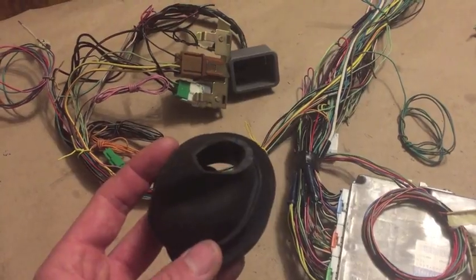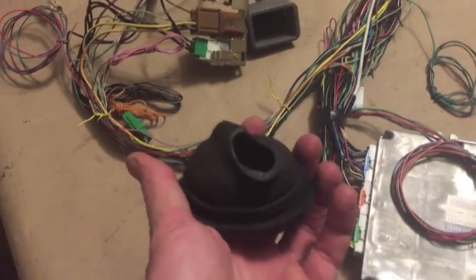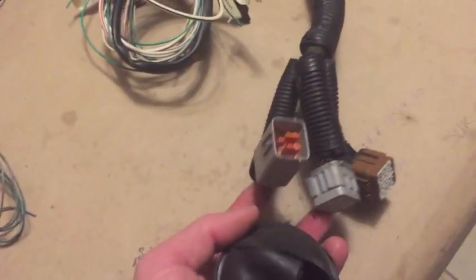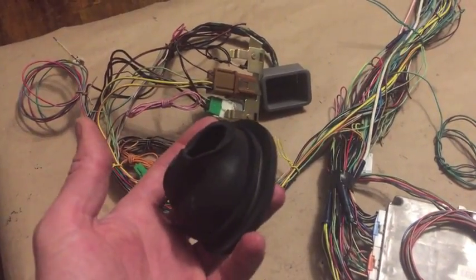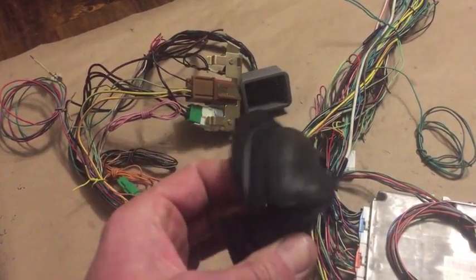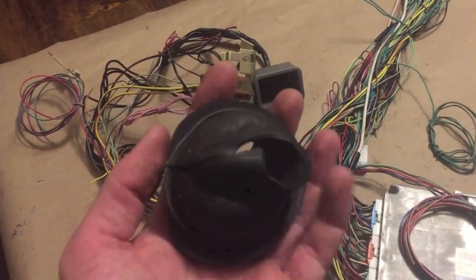A quick note: I usually use this grommet — it's circular in shape and squishes into a circle. A small hole saw will do the trick in the firewall, under the seat, or underneath the Westy cabinets. It's great because you can fit these massive connectors through a hole that size. If you try to feed them through a grommet that fits too snugly, you'll be in a world of trouble. Now's a good time to thread it on. This particular harness had it cut off, but I may still include it since nothing at the store will be this size.